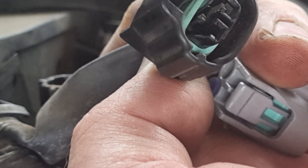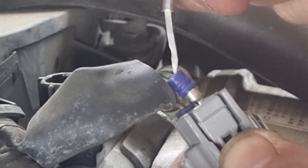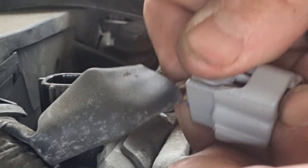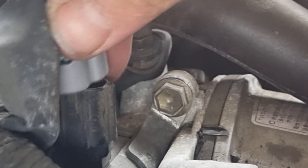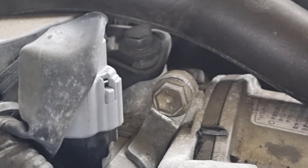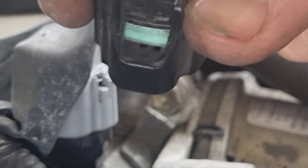That one's done. Now out comes this other one — again I'm going in here. You can see this connector is just completely falling apart. Into pin two of this one. I actually have done videos on refabs on a lot of looms and I've just recently filmed one on a 3Z loom which I'll be editing — if there's a card up above, that video is done. Push the lock tab back in and then it goes. About three, three and a half minutes to change that connector.